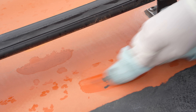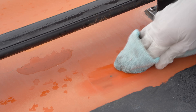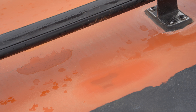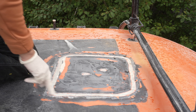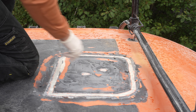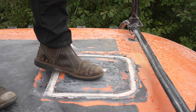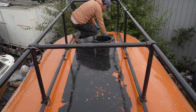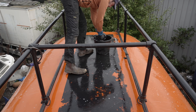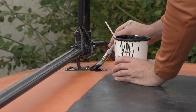Acetone gets it off — a powerful solvent I've learned to only use when I don't care about the surface finish. It dulled the polyurethane gloss paint when I tried it elsewhere a few weeks ago. Another false shortcut learned the hard way. I needed to carefully sand back the repair to the panel I cut out in episode 21 until it was flush. It was a belt and braces repair where I cut in a groove and overlaid glass fibre to the perimeter — I didn't feel a mere line of sealant would be enough. Before coating could commence, naturally a good wash down with sugar soap to degrease and clear any dust or gunk.